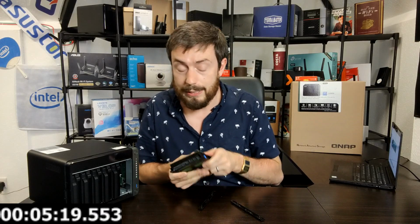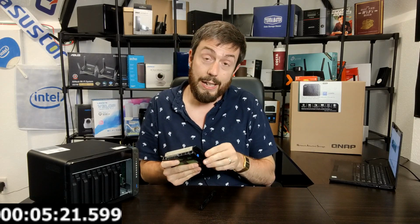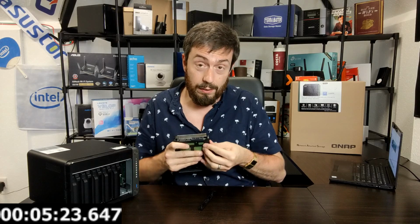And that's why when you get bigger NASes, it opens up RAID configurations like RAID 5 and RAID 6, which give you 1 and 2 disks of safety net respectively, due to them working on a different system of data being written, utilizing something called parity. With every wave of data that is written onto these drives, on every wave, 1 disk is selected, one by one, to have a blueprint of the data on the others.